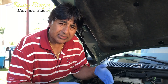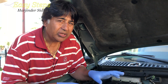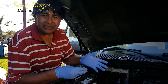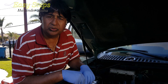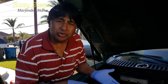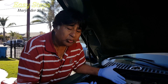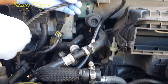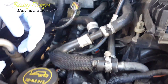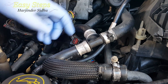The misfiring cylinder three points to spark plug three and this is very hard to remove — it's really not an easy or fun job. I removed the coolant line; it just takes one small screw to take it out, which makes it easier. I also removed the cables going on each coil.